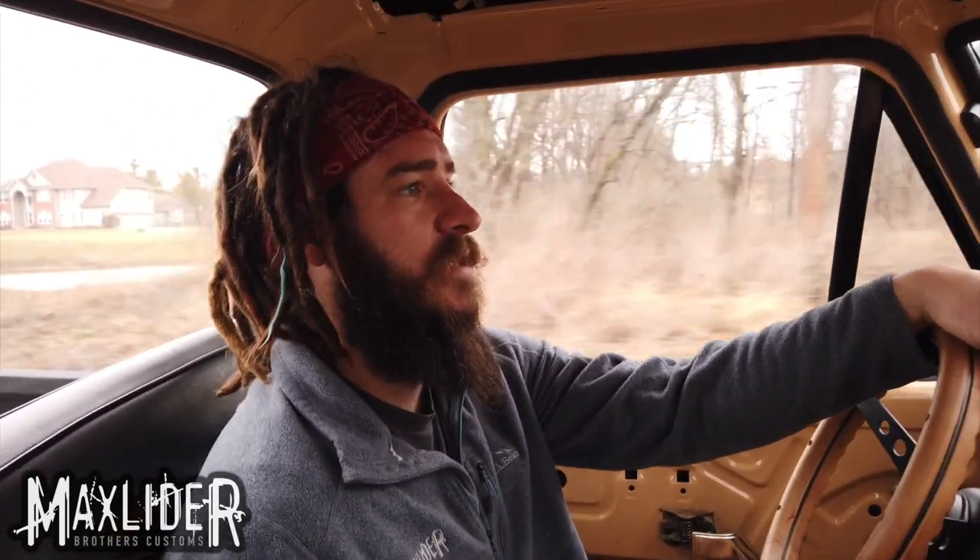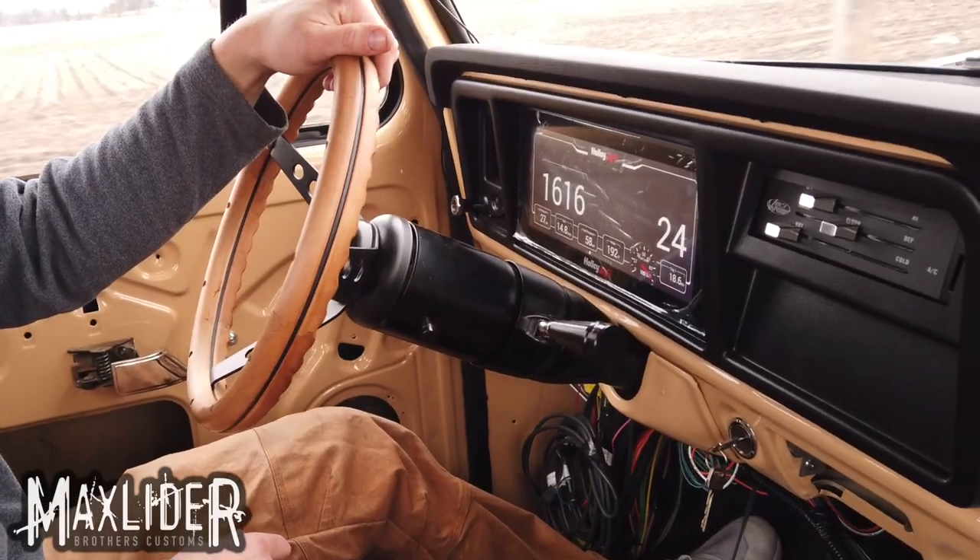And then it'll be test miles after that — I want to do a minimum of 300 miles. Those 300 miles, we've got to do nighttime miles just to check the headlights, make sure everything there is working correctly. We want to do morning miles, daytime miles. And then we want to do miles where we actually go somewhere, try to reenact how the customer would use the vehicle — not just out in the country where we're left alone, but going to the city, hitting stoplights and stop signs, making sure there's no overheating issues and that the ride quality is still good in the city.